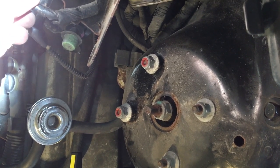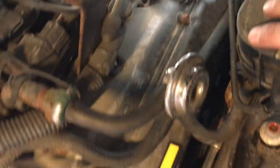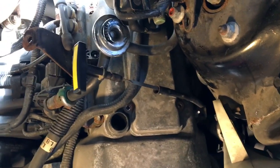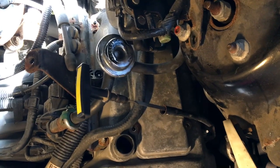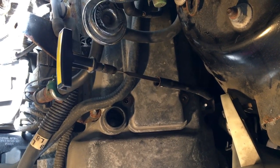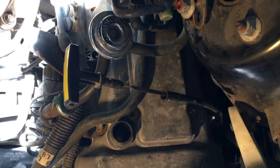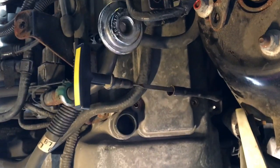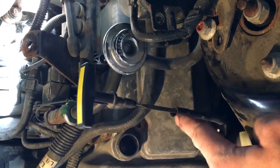With that bracket out of the way, this should help me when I go to get the valve cover access panel off — those are 7 millimeter bolts. A couple tips for this side because it's difficult: I used a deep well 7 millimeter socket for all three top bolts. For the bottom front one, you can spin the socket wrench without getting into all the stuff close by the valve cover. The oil dipstick was in the way on one bolt, so I just pulled the oil dipstick up — that gives you enough room to come out with the socket.